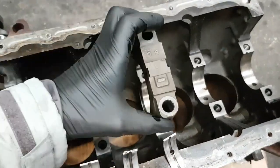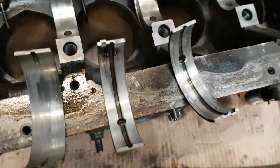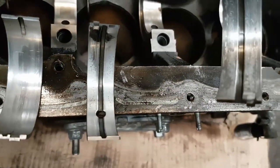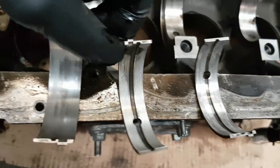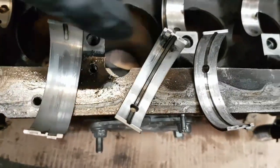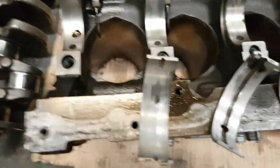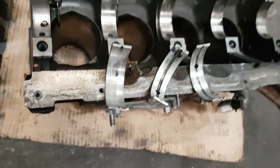These five recesses are where the bearing shells sit, with the crankshaft sitting down in there, and bearing caps sit on top. Look at the wear on these shells — quite a lot of white metal has worn off that shell, and some on that one, and on this one there's a little bit with a lot of scoring.